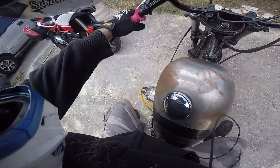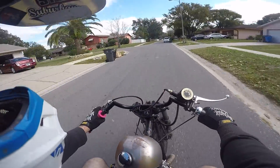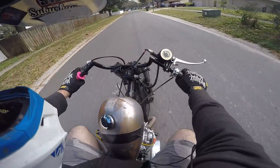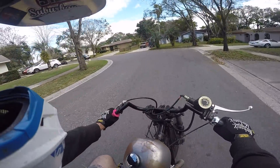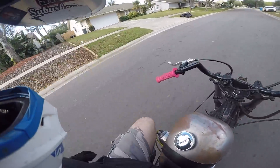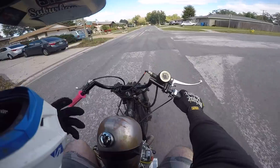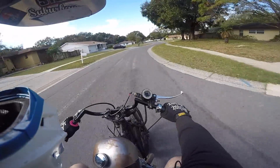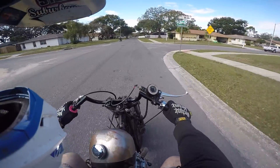Well, this is going to be a really short test ride — can't really test the brakes if the bike doesn't move. I'm just going to ride around and only use the rear brakes, not even touch the front brakes, and see how they're doing. Hey, they stopped the bike — they're doing what they're supposed to, which is make the bike slow down. I can hear a little bit of protest from the brakes since they haven't been used in quite some time. I don't know if things are a little gummed up and they're not releasing like they should — they're dragging a bit when I let off the brake — but they're working. My stupid little rod is working.